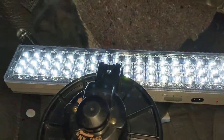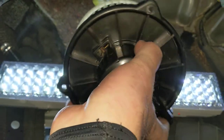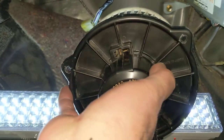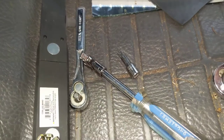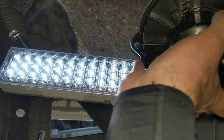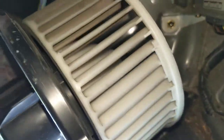The last thing I wanted to show is kind of a puzzle — I didn't want to have to unbolt everything underneath and drop a whole bunch of parts just to get this motor out. So I took the three screws out, which was a little bit of a challenge to reach the back one, but it worked. I used a quarter-inch drive with a little universal on it and was able to get that third screw. But then I couldn't get it back in, and I couldn't remember what orientation the fan was in when I put it back.